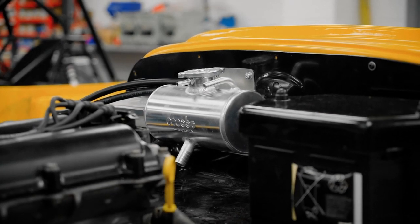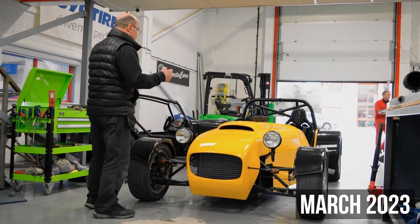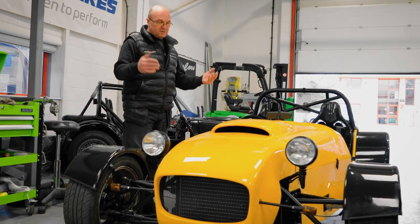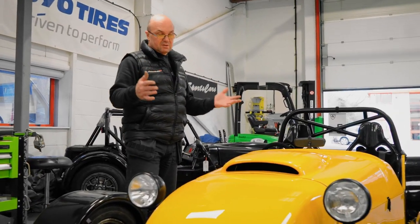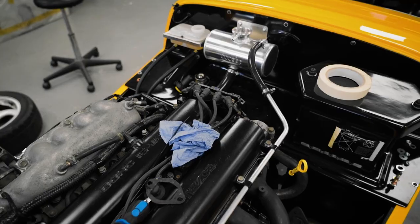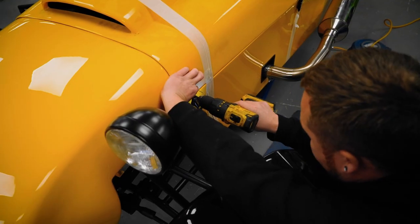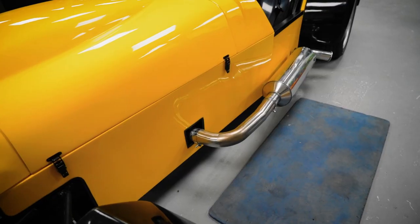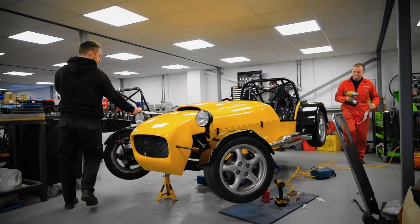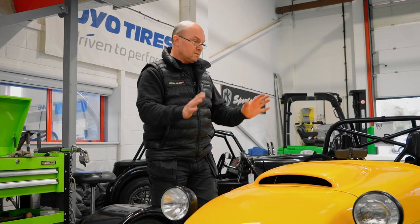So we've gone with the early one. Yes, it's on the ground, out of the bay, which is behind there. What's the reason? Well, it's getting its final stretch down to the IVA process. So what we've been on with this week, a few little touches and other bits as well, but under the bonnet here, guys have been doing all the coolant system on it. The guys have been plumbing it up, getting that done so we could run it up to temperature and give it a road test. We fitted the new bonnet catches on here, which are the lockable metal ones. They're really good, they click, really safe. For IVA, you do need a little rubber cover that goes over those if you're fitting them for pre-IVA stuff. After IVA, it doesn't matter.